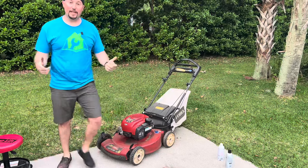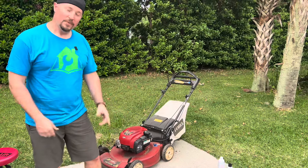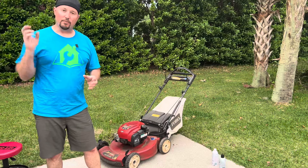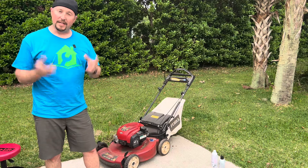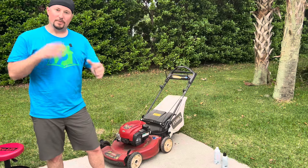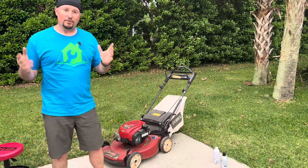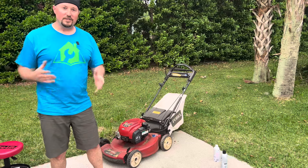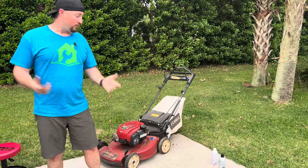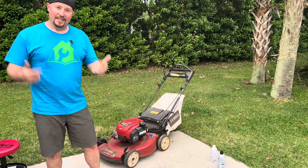I hope that helps you out. I know it can be really frustrating when you go to get your lawnmower out of storage, or you've just been using it regularly and all of a sudden it won't start. Check those three things first. If none of those work, more than likely you have a carburetor problem — you can try to rebuild it, clean it, or just buy a new carburetor. But nine times out of ten, doing this is going to help, and that fuel treatment and starter fluid will also help clear out debris. This channel is full of simple fixes for household glitches, bigger projects, and general tips for around the house. Subscribe, and let me know in the comments if this worked out or if you're still having trouble. Thanks for watching — remember, if I can do it, you can too.